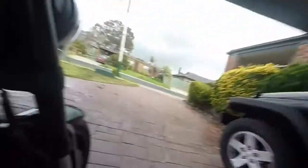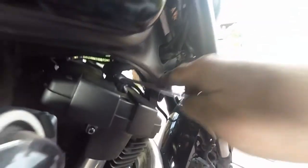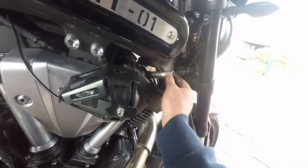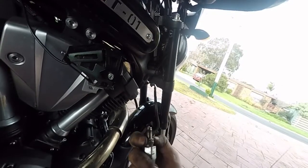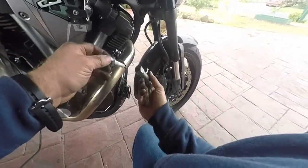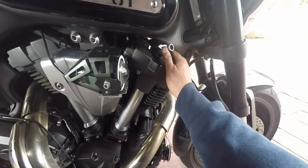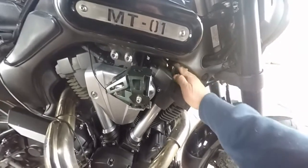Glasses on. We're on this side now. As you see the key's in there, I've pulled the cable out, put the plug key on the plug, and it's just a matter of unscrewing it. A lot of people find it difficult trying to get this side off. Once you've got it screwed out, pull out the plug like that — there's a bit of wear on that one as well. It's harder to put in, but we'll pop the plug into the tool like that. We should be able to just clip it in, gently drag it across till you find it pop in the hole, and then just turn it so it starts to screw in.